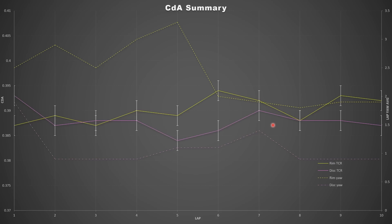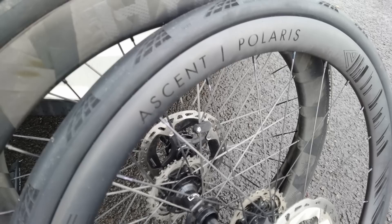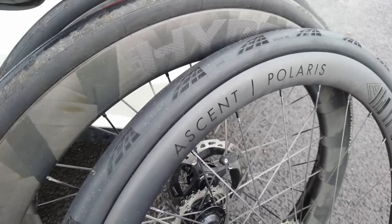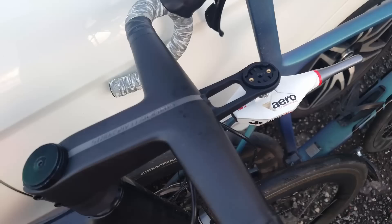To put this into perspective: when I do wheel aero testing on the disc brake bike, I've had much bigger CdA differences between two wheel sets than between these two bikes. Component-wise, these two bikes are pretty much identical in terms of CdA. I'd expect the disc brake bike to be a bit more draggy at the front end, but a few things mitigate that — the Di2 disc bike has a lot more hidden cables, while the rim brake bike is messier at the front. However, the rim brake bike does have the aero bar, which we tested to be about 4 watts faster at this test speed.